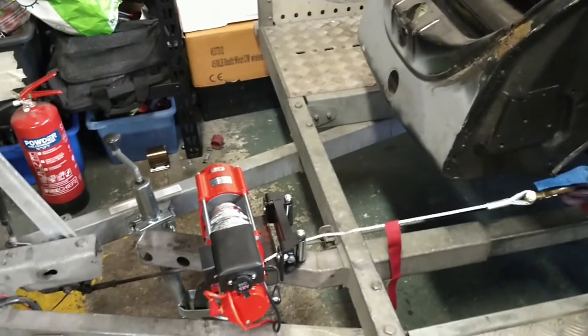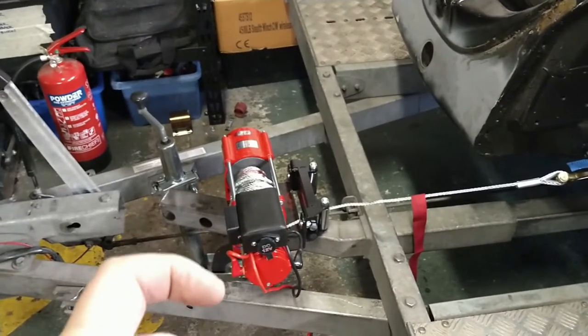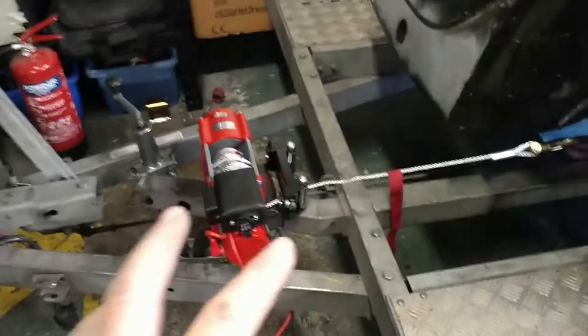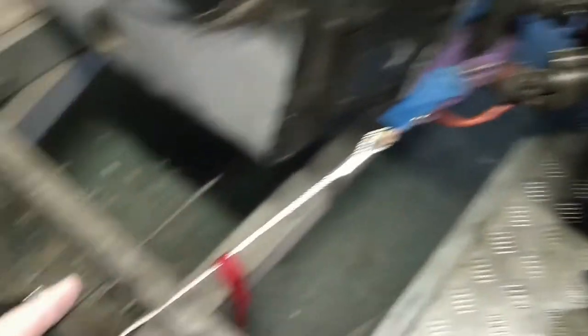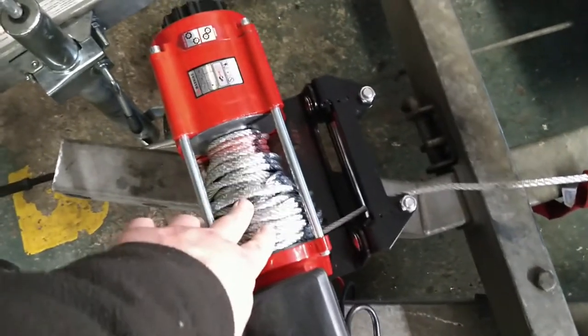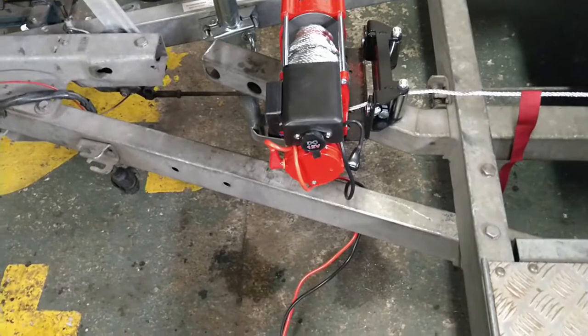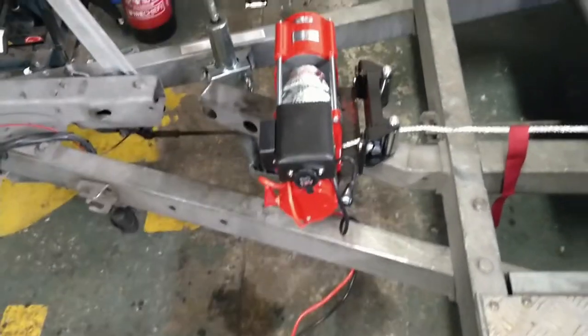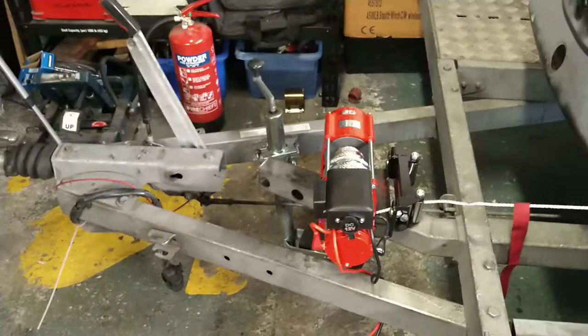That was really easy. It was possible to steer the car and winch at the same time, which is so much easier than using the manual winch or even using a drill on it like last time — and I could be at this end of the trailer to winch it up. A couple of comments on the winch: because it's fastened to one side and this is more towards the center of the trailer, the cable is bunched up on one end of the drum — not a massive problem. Also, there's no manual override, so if the battery's flat or fails you're stuck — it could do with some kind of handle. But for the money I'm very happy with it; it looks the part, works well, and makes getting immobile cars onto the trailer significantly easier.